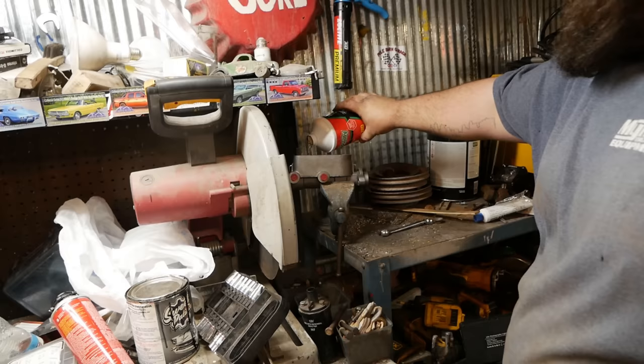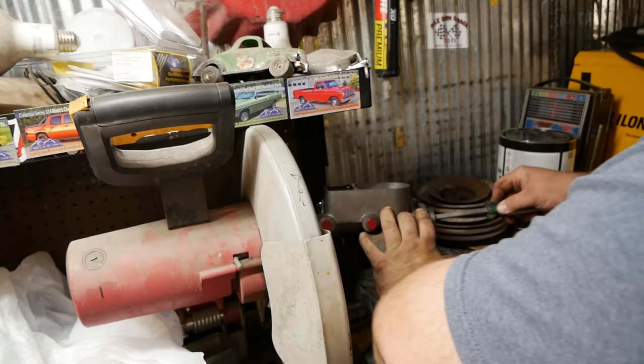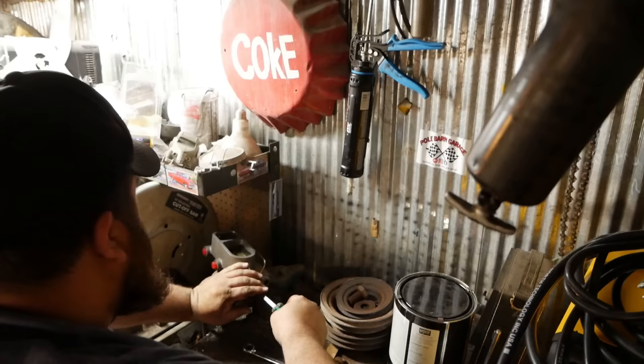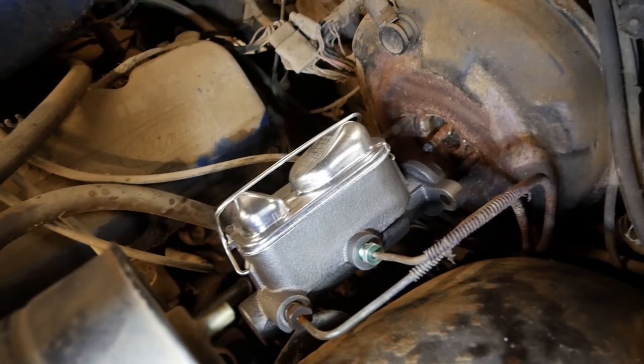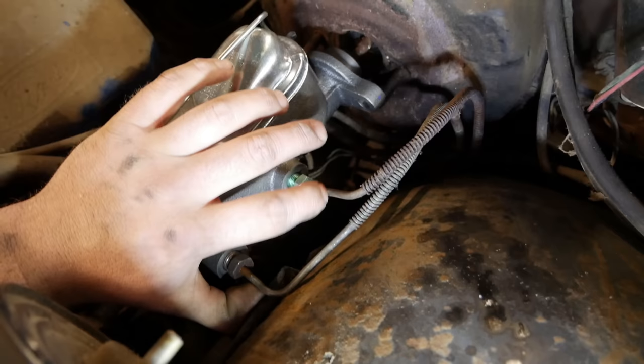The key here is just push until bubbles come out. When the bubbles stop, it'll start to stream fluid and the piston will get harder to depress. We're ready to go. I'm going to pop this on, tighten those lines down, and hopefully we get away without opening up the system. You might notice that if I try to install this, the rear brake line runs into the fender well here — and that's an issue.